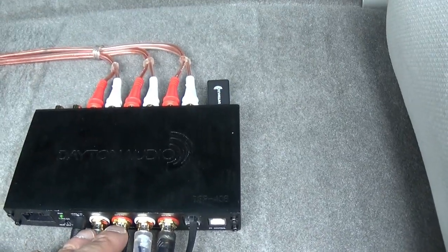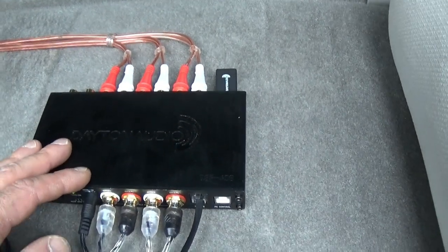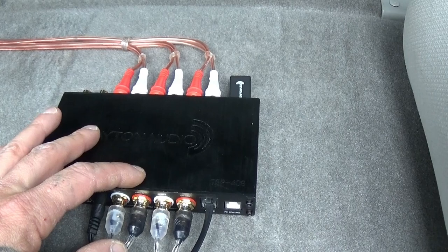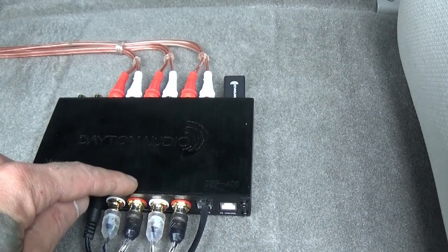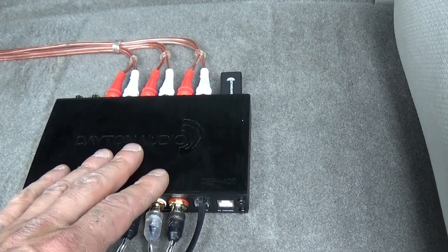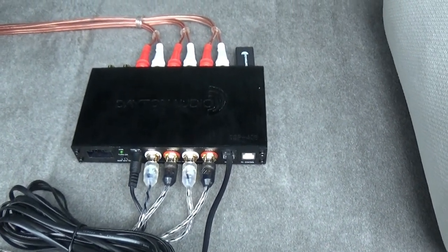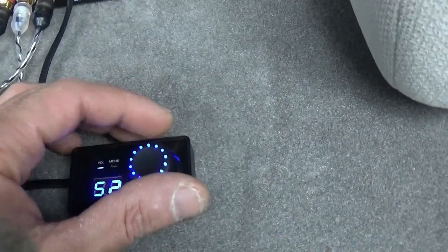These ports are set up for my subwoofers — they have a low-pass filter set and output at these RCAs on this side. The reason I have it set like this rather than all outputs listening to all inputs is because on my head deck I have subwoofer control. I can push subwoofer on or off and it turns those leads out. So when I kill my subwoofer I kill all the output to my subs, but I still remain with my high-pass and run my mids and highs. If you look up DSPs and do some research, or if you're familiar with digital signal processors, you'll understand what I'm saying.